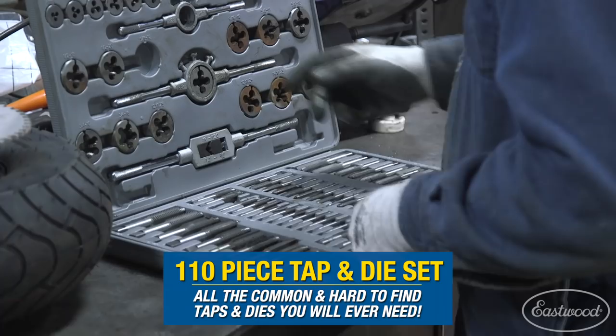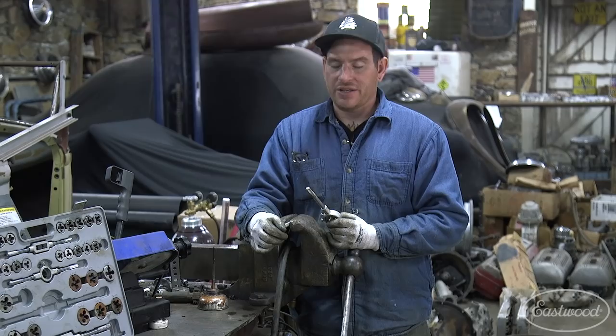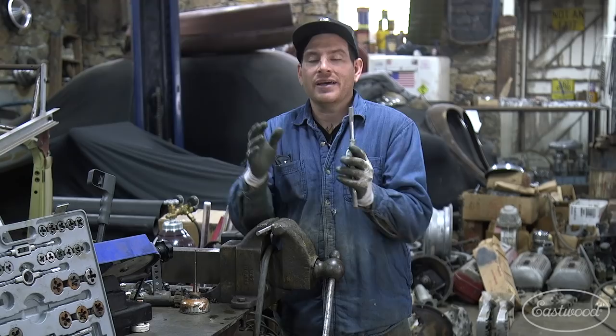All right, so I got the axle that we made turned down. I replicated the original axle that was supposed to come with the wheel, and it has a shoulder on the one side, and then the other side is threaded, so you slide everything through, you tighten down the one side, and it pulls tight. Now, what we need to do with this, because of the difference in the frame and the axle and the wheel, is we need to make little spacers that are going to touch on the inside bearing surface on both sides, and then when we tighten it down, it will tighten on that and actually ride so that the bearing spins and doesn't bind it.